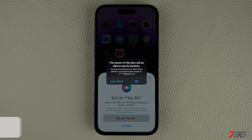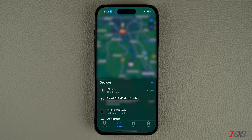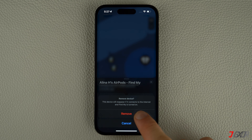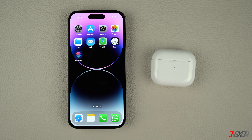Please note that newer models, starting with AirPods 3 and Pro, can't be paired with a different Apple ID if they're still connected to another account. To remove the iCloud lock, open Find My on your iPhone to unpair the AirPods from your previous Apple ID. In the Devices tab, select your AirPods from the list, then tap 'Remove This Device' and enter your Apple ID password to unlink the AirPods from your account.